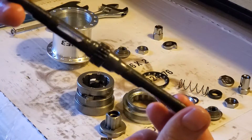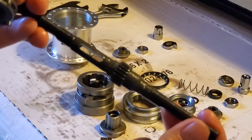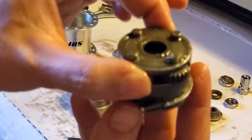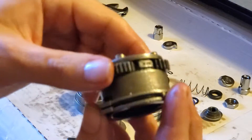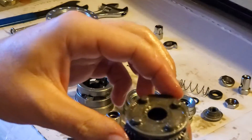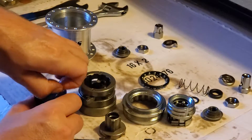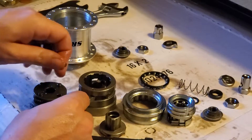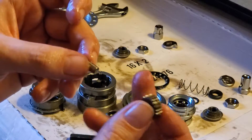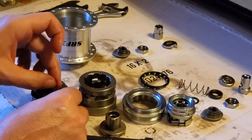The axle is a little bit different — it has a bulge right here and this slot is a little bit more lengthy. The whole axle, like I said, can work with a 135 frame. This planetary cage has a circlip ball so you don't have to worry about that. Each of these planetary gears are held in with a pin — it's just a straight pin. The gear itself is very similar to the AW; I think it's the same size, but the pin doesn't have a little tip on it. I'm just going to leave them in there.